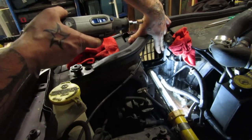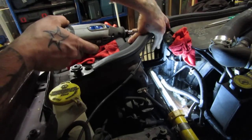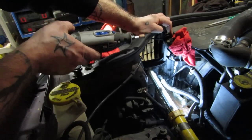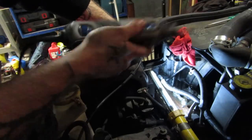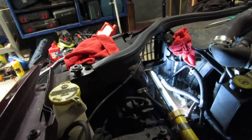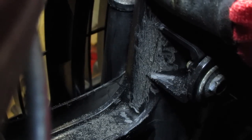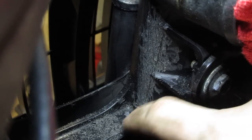I scratched up the whole area to get a good scuffed surface for the JB Weld to adhere to and dug into that crack a little bit. Key thing - any tool you're using, keep it on low speed. This plastic is nylon, which is what they use on radiators, and it melts around 400 degrees. If you start melting gouges in it you'll make a bigger mess. I had the Dremel on about a quarter power. There were some spots I couldn't reach, so I used the 80-grit sandpaper to scuff those areas.